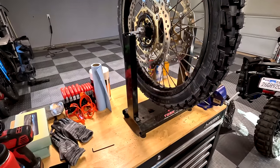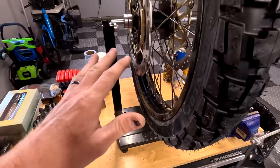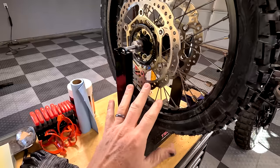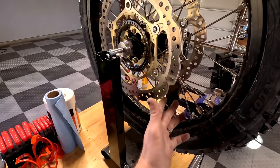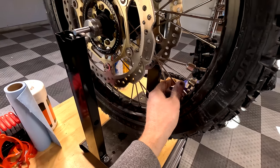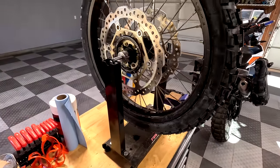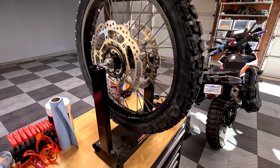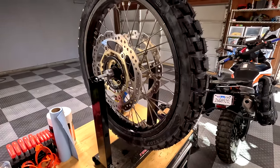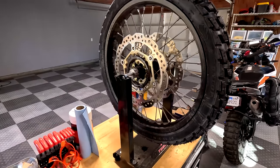It's time to balance the tire before we remount it. I use the Tusk balancing stand — I'll link everything below in the description. Really affordable, and I like to balance the tire because it really gives a much smoother ride. You can see they did balance it from the factory; however, these weights had already come loose, which is surprising for Honda. We'll find the heavy spot, balance it out with some weights, and then remount the tire. Actually, this was about as easy as it gets — front tires are easier because they're less stiff and a little easier to work with. No problem getting that mounted up with the tube.